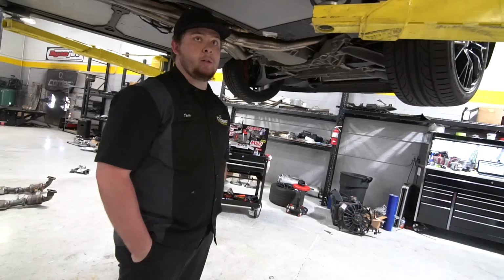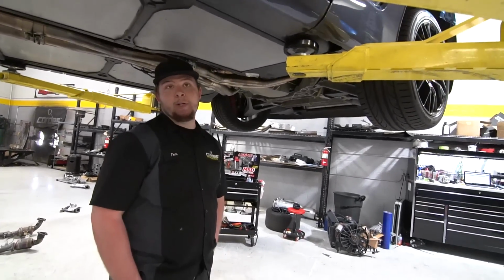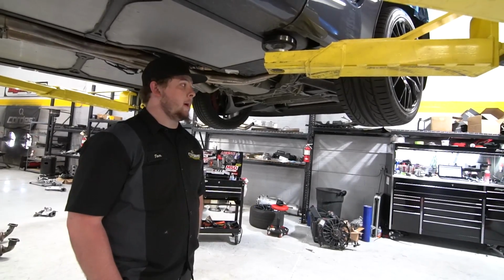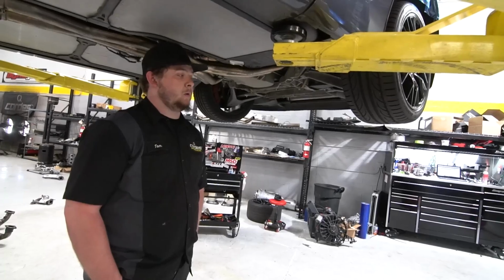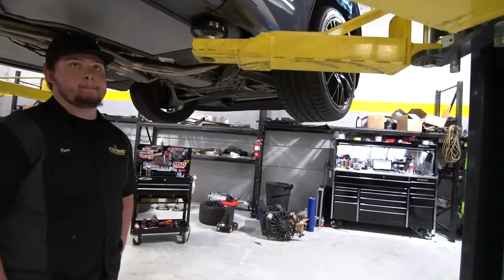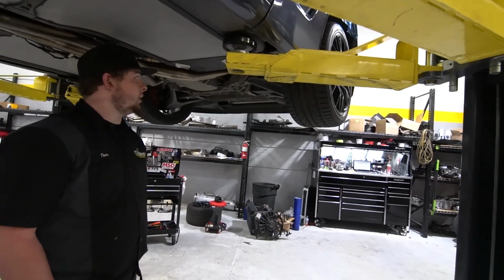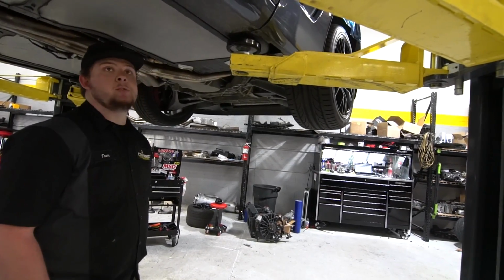We're doing an A-rib on this, and the power steering pump pulley, even when it's pressed on all the way, it's too far out. Oh, bummer. So you gotta get it turned down. Yeah, we sent it to the machine shop to get it turned down, and so it'll go on. Joe was literally talking about this yesterday. It'd be nice to have a lathe so that we could do that ourselves, you know? And I'm also waiting on a transcooler.